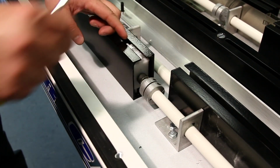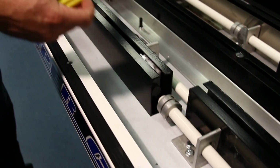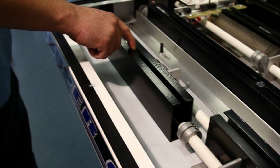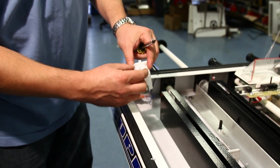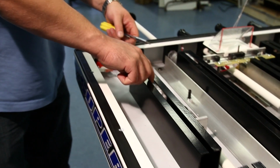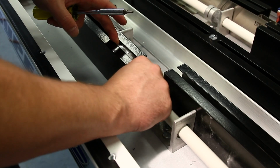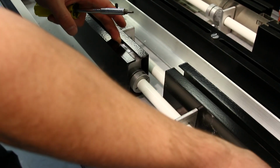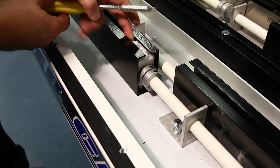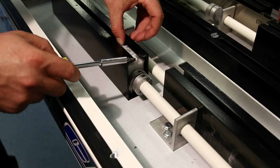When loosened, the collar slips off the gearbox, allowing you to slide the gearbox out of its channel for removal. Notice the player lock washer floats on top of the gearbox. These lock washers, located over each gearbox, are important to secure the player's shafts into the gearboxes. To replace the gearbox, slide it back into the channel in order to mate it back up with the collar.